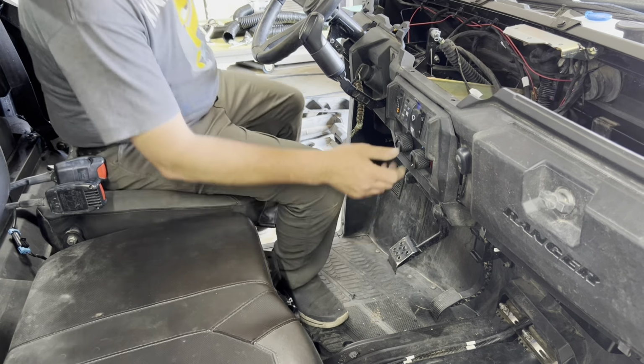Now, we are going to start it and run it and then watch our temperature. At 99 degrees right now. Anyway, you want to bleed everything with fan on, temperature to the hot, fan on, temperature hot. That way it has the valve open, that way we can circulate. Now it's just a matter of running it.